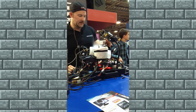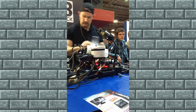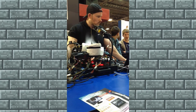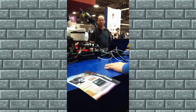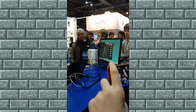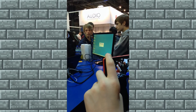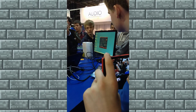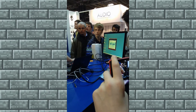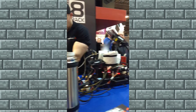We're stuck here, we're not going into Windows. There we go, in Windows here, just shot 6 GHz. CPU-Z shows exactly that — 5.98 GHz. Temperatures on the CPU now minus 171.5. Nitrogen now is not going to boil off so quickly, because the pot is almost effectively as cold as the nitrogen.